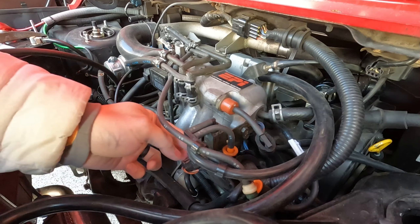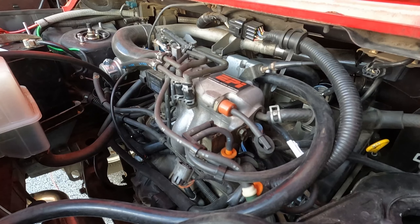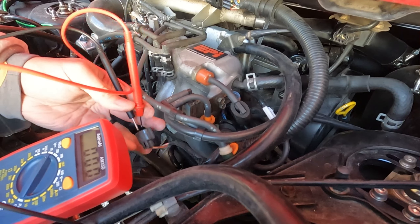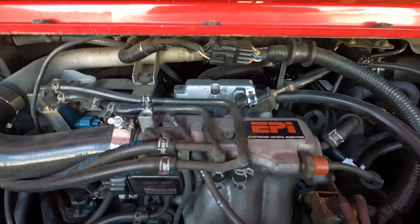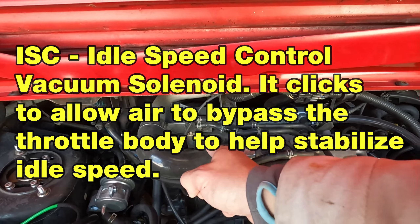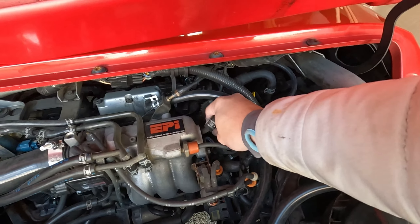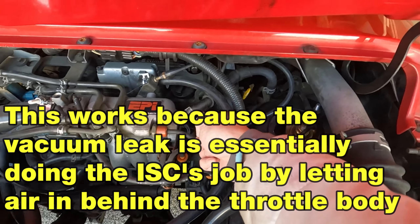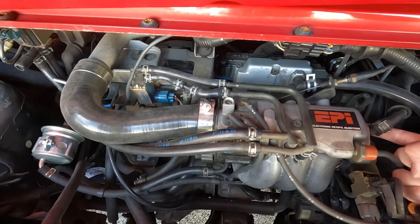I'm going to turn the car on and check to see if there's 12 volts to these pins here. Something odd is going on — something over here is clicking. I think it's the idle control solenoid, or idle control valve. It only clicks if there's full vacuum on the engine. So I'm going to pull this out from the intake manifold to make a leak — and it stops, no more clicking. If I put my finger here and plug that nipple back, there it is — it starts to click again.